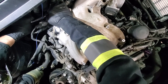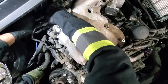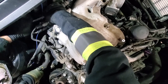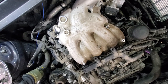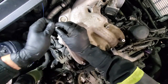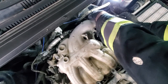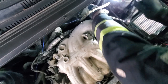When you get this tight just put a little bit of pressure on the back of the air intake — lean against it just to make sure the bracket is holding it down. It won't hurt — you'll just have that extra support from the bracket on the back. Next, attach those lines with another 10 millimeter bolt. Now do the other side bracket on the back — same thing, lean on the intake, get it tight. That one was 12 millimeter.